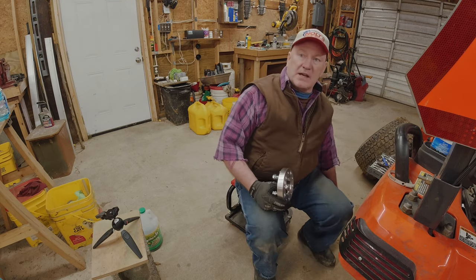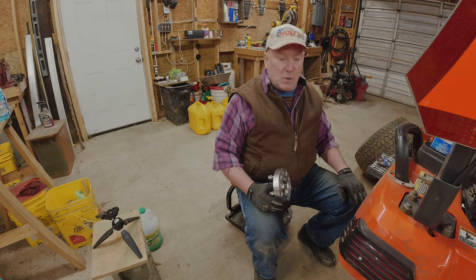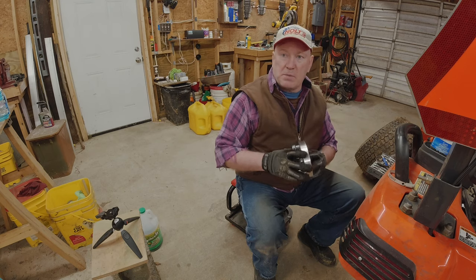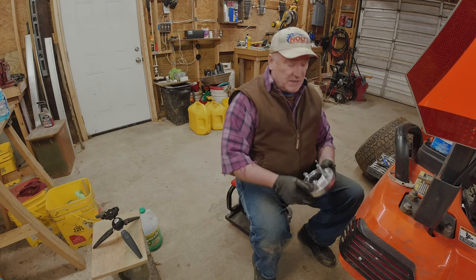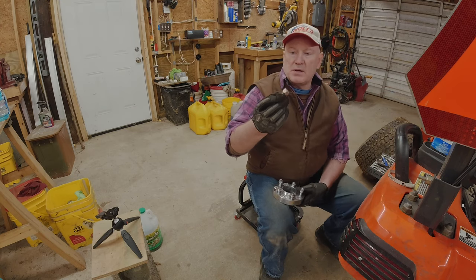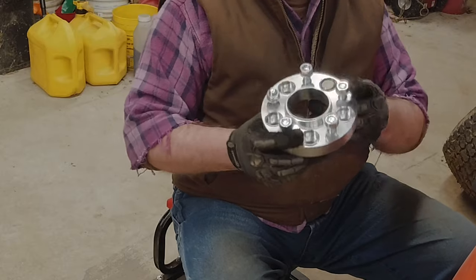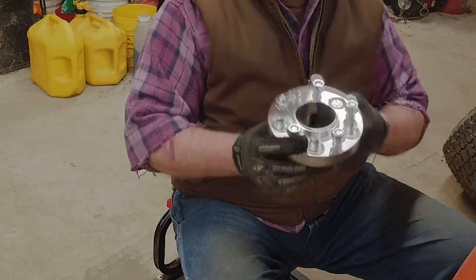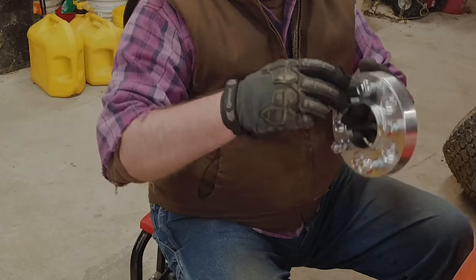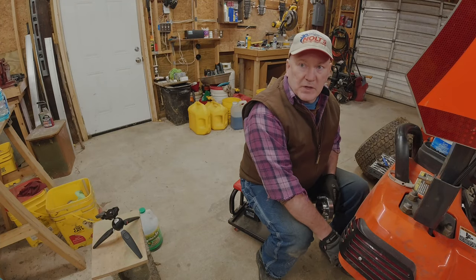I was concerned about hitting my anti-scalping wheels on the mower deck. I won't know that until spring when I put the mower deck back on. Worst comes to worst, I'll have to remove the spacer and just run with the straight hubs, then put these on again in the fall as part of my fall service. Originally I was going to use the bolts that held on the wheels to hold on the wheel spacer, but the problem is the 13/16-inch socket will not fit inside the recessed hole to secure the bolt — that's why I had to put these Triton studs on.